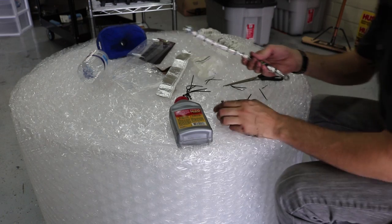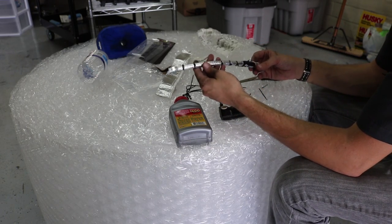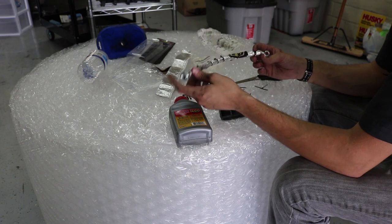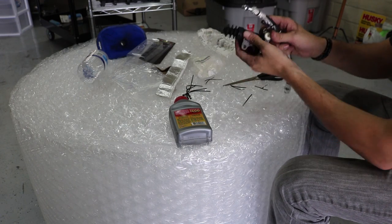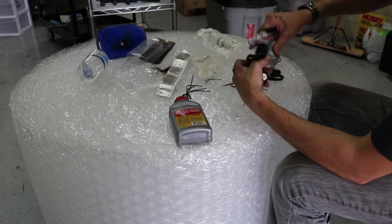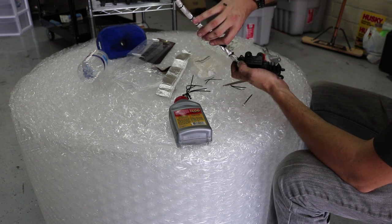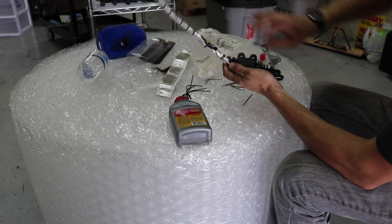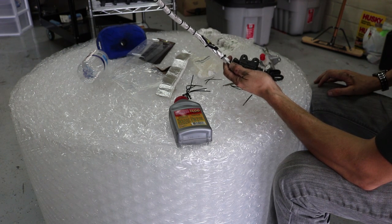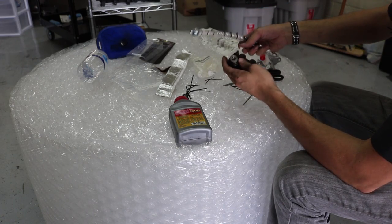I've probably put a little too many zip ties on here but I got carried away while talking on the phone. Now I'm going to figure out the position I should put this line on so I can tighten it down. I know this bleeder valve is supposed to go on the top, so I'm pretty sure it's supposed to go something like that. I'm going to go take a look at the other slave cylinder and see what position I should put this line on.